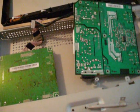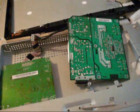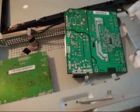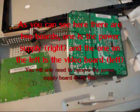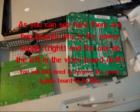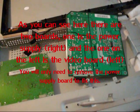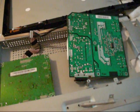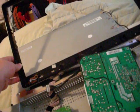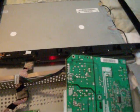Alright, this is the Samsung 226BW LCD monitor. When your monitor begins to flash or won't turn on at all after a period of time, it is because the capacitors inside are bad. So you need to take it apart — it's fairly simple to do. It needs about 4 screws in the back of the plastic screen, and then the rest is prying off the front bezel with a flat head screwdriver or a putty knife.